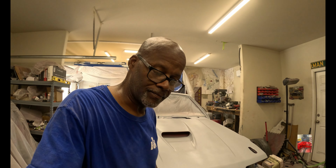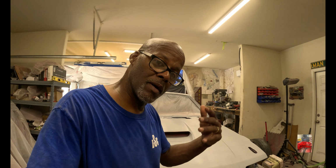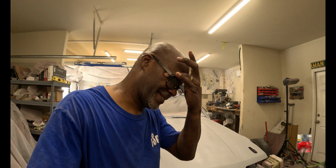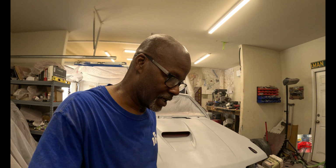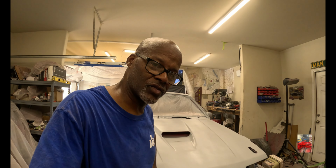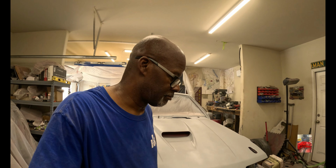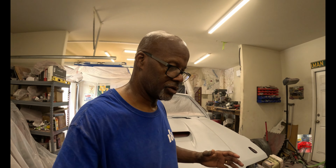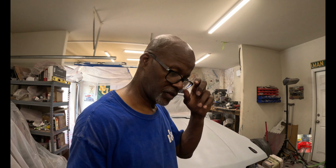Oh, another thing about that, too. So, I went back to the painter shop, should I say the painter store. I got some more paint, and I asked the guy, I said, man, I'm just having all kind of trouble with this paint. Not actually trouble, but to me, it's not laying down correctly, or it's too hot outside and it's streaking up real fast, or something. And he asked me, was I putting hardener in it? I said, yeah, I'm putting hardener in it. He said, well, you don't need to. This here is ready to spray.